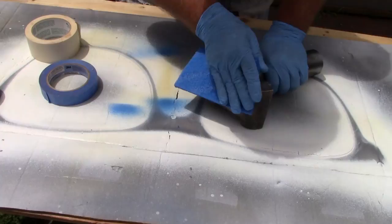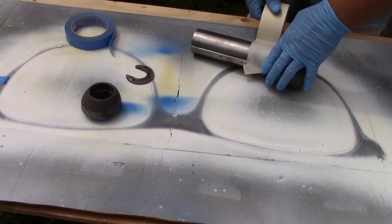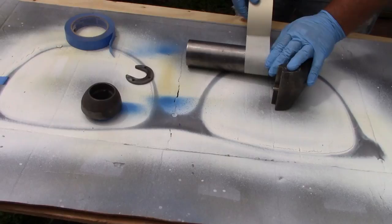The first thing I did after the electrolysis process was go ahead and scrub everything up with a Scotch-Brite pad. Then came the fun part — masking off all of the machined surfaces that I didn't want to get any primer or paint on.